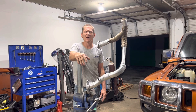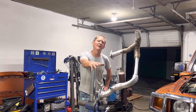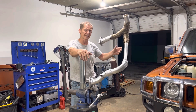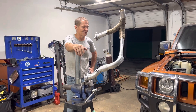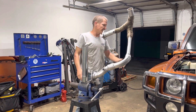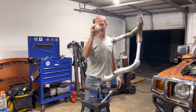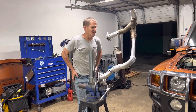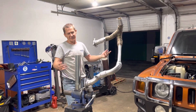We're going to straight pipe where the cat was for now. Later on we could entertain getting a pair of cats, or one large high-flow cat. There's not a lot of room, and we can't find the correct left-side manifold, so the factory H3 5.3 down pipe with pre- and post-cats isn't an option right now — and it would really hurt the cost of production anyway. The BTR stage two truck cam would much rather be happy without the restriction of a catalytic converter. Here in Florida we don't do emissions testing, so it'll be okay for now, and maybe later we'll look at an upgraded exhaust.